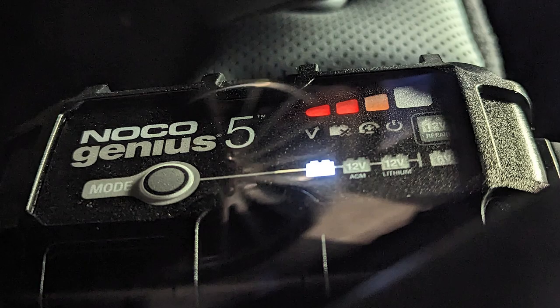After fully charging the vehicle, I used it for 1 week, and when I plugged it in the next week, you can see here it actually dropped one level, which means it's about 75% of charge. Having such short distances may cause the battery to slowly drain. If I actually did a longer drive, it probably would charge up, but gradually over time the battery capacity will drop to a point where, when it gets too cold, it will drop beyond the point where it can start your vehicle.